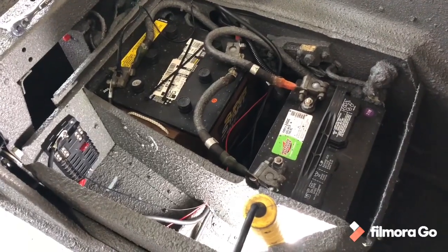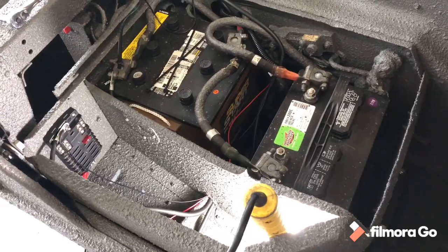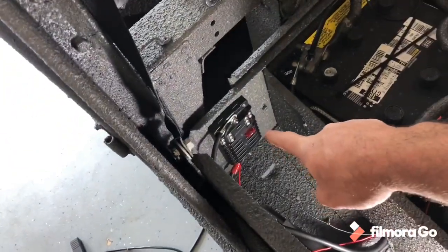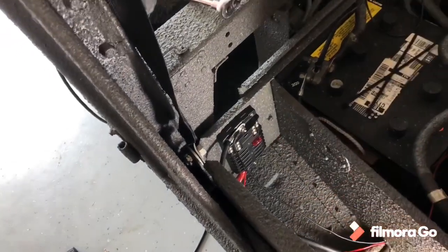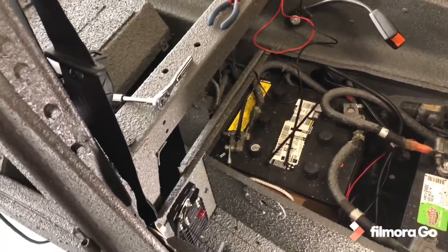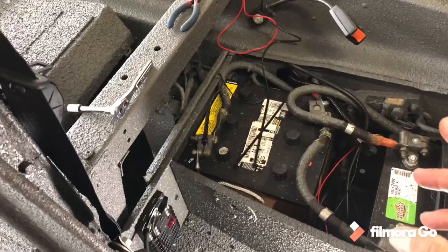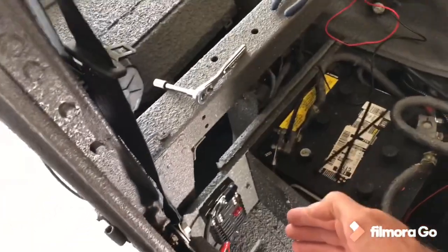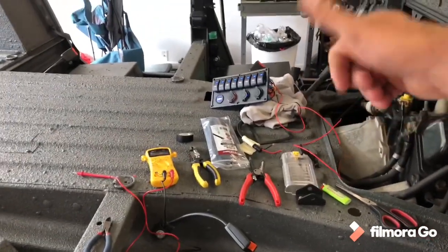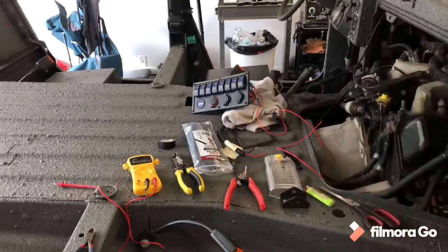Getting 24 volts — I don't want 24 volts. So I'm going to hook up a temporary wire from where I put the 10 amp fuse right there. I want to see what the amperage is. I think it's still 12 volts coming out — which it should be — but I don't want, when you flip the actual switch, since that already has 12 volts, does it change to 24 volts. That is what I'm trying to find out right now.